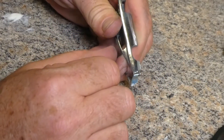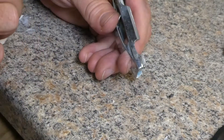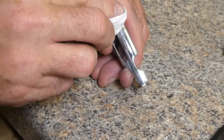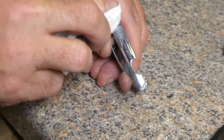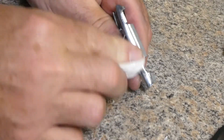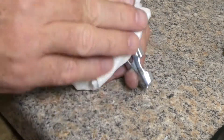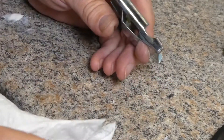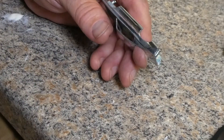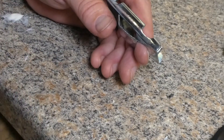It's all rough and pitted right there. I might have to hit that with the Dremel before we zinc it, because that's definitely going to need some zinc right there. It's just never going to shine otherwise. Zinc is what shines through — it's kind of like metal flake in today's paint. If you've got zinc underneath a paint that you can see through, you kind of see all that shininess come through the paint.